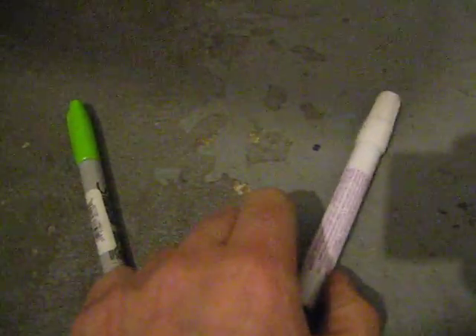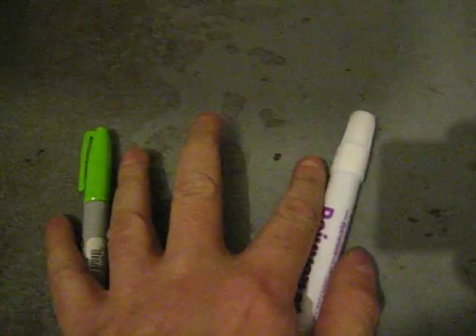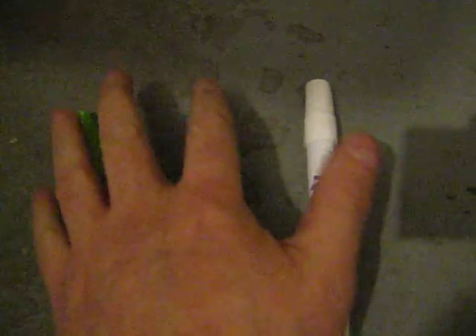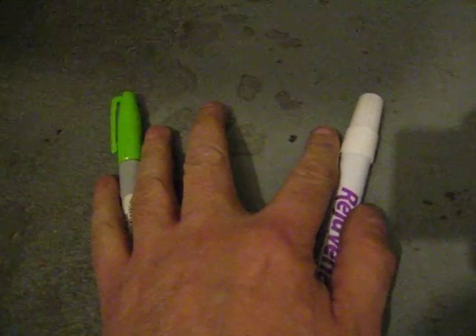Okay, so part two. I was told that my steering was pulling to the left and I will have to adjust to the right. Both wheels will turn like this — I'm exaggerating, the wheels will actually be parallel, I'm just not very good at using this pen. In this situation I will adjust this one and the steering wheel will turn to the right.